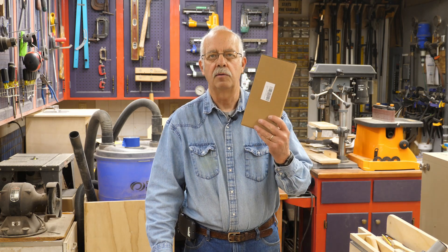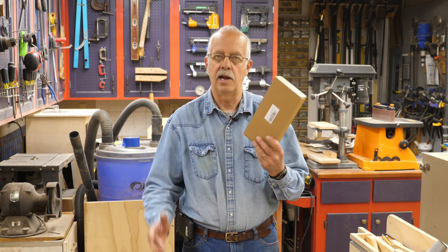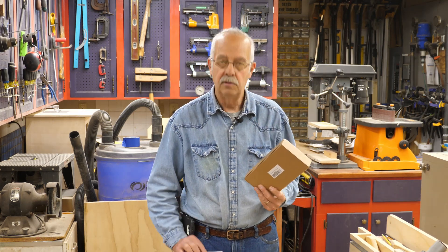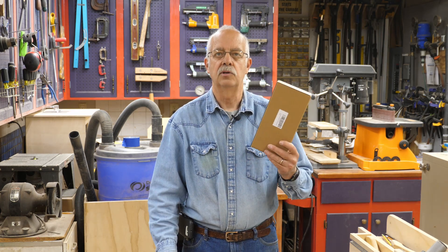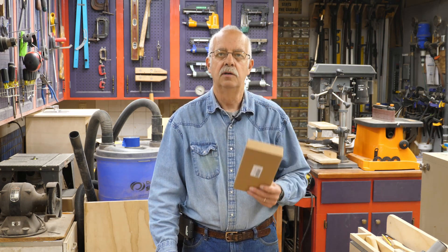I got another new main board in it, tested with a bench top power supply made for testing electronics, and had no issues. After that, I tested the original power supply several more times and found that every once in a while it'll start up and overshoot that voltage. So what I have here is a replacement power supply for the Ender 3 V2, or any of the Ender 3 printers, from Amazon — $30.28 with tax. I'm going to head up to the loft, put this in, and hopefully have a working printer.